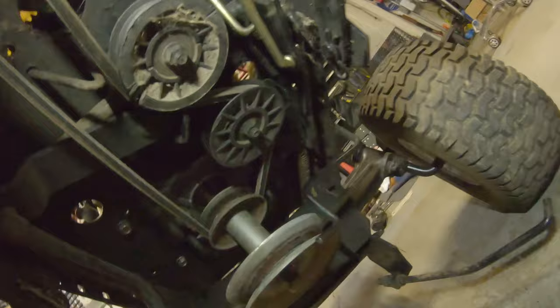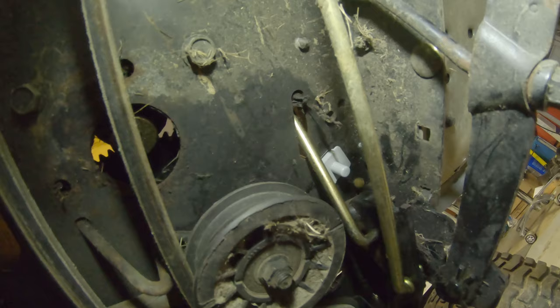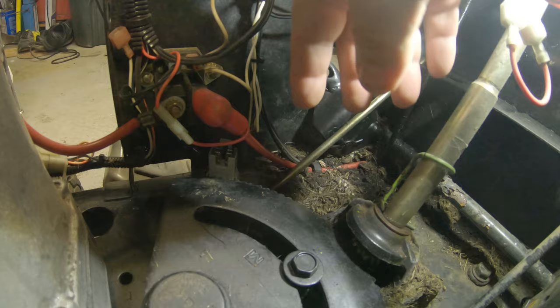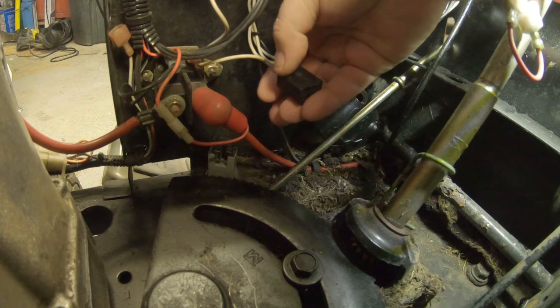Put that in there so that when you reach out and push the brake pedal down, you can see how that works now. You can hear that switch clicking. We'll get it hooked back up and make sure it's working. Once you get that switch in the bottom, come back up here on the top. I did put this switch in backwards — this clip was on the front, I've now got it on the back. It doesn't matter other than the fact it's going to be a little harder for the next guy to get it out, but for wiring purposes it doesn't matter. Just make sure when you put your plug back in, you turn it the same way so it matches the switch, and get it seated all the way down.